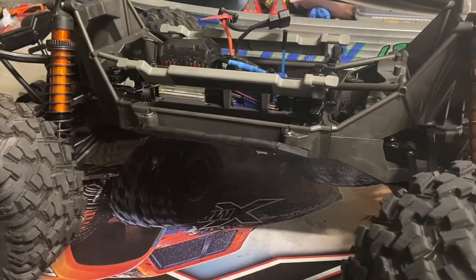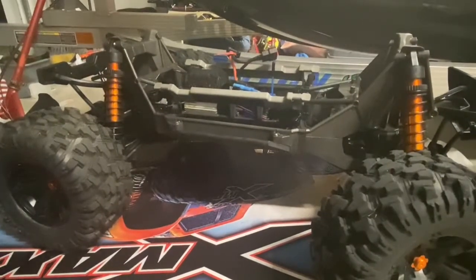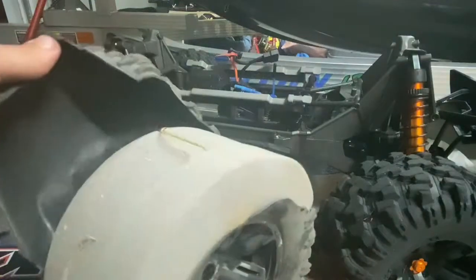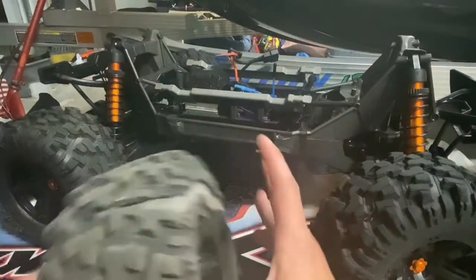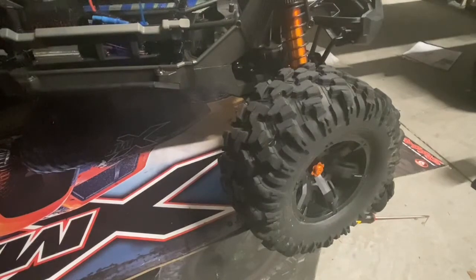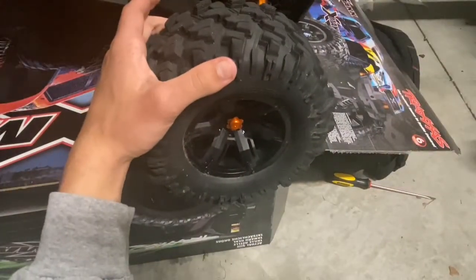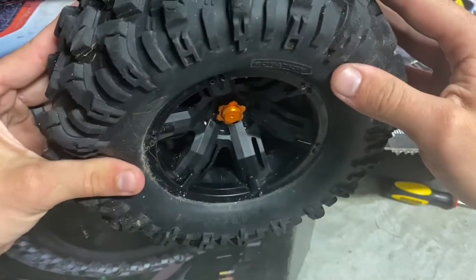The only other problem I've had is a blown tire. I blew a tire on the third charging cycle. I was probably at three quarter throttle, the tire was spinning, and these tires tend to balloon — meaning when the tires are not touching the ground at high RPM you'll see the tire expand rapidly, and that causes wear issues. Now I'm going to show you what you can look for: we're going to look for cracking and separation on the tire bead.